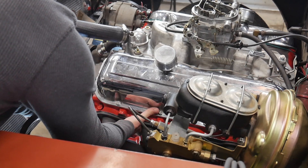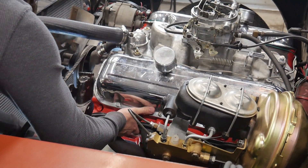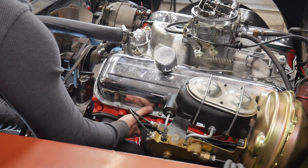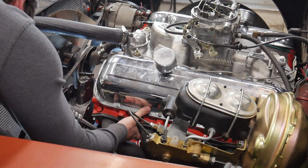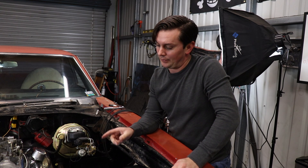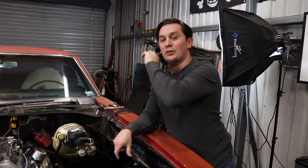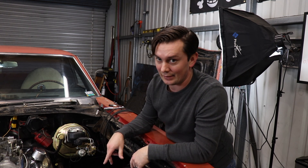Don't put your finger in the hole, just over the hole. There we go. Once you do that, I like to put a white mark on the timing marks on the balancer as well. I'm going to put that mark at about 13 degrees. That way, when we fire this thing up, we just need to bring those two white dots together.